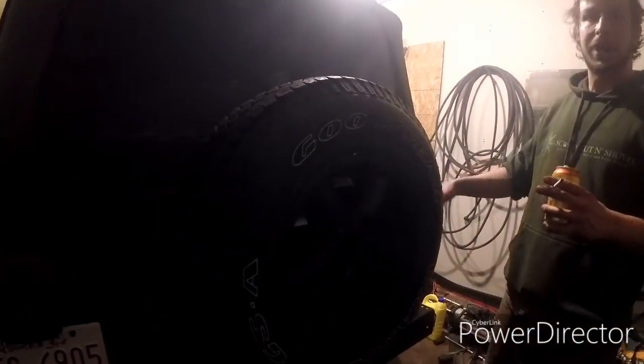We got the third brake light off and the tab here that was just in the way of everything. So if you want to mount a 33 or 35 on the back, if you're going to do a 35, reinforce your tailgate. But a 33 should bolt right on without that third brake light there. And once you put the third brake light on, we can get an LED red strip and wire it right into the wires that are here and put it on the actual front of the tire.